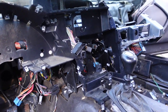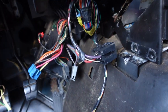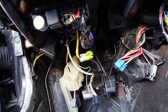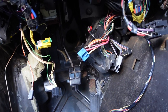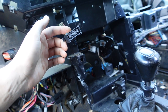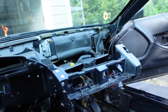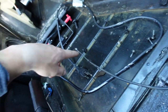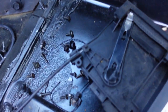I've been taking pictures and this video will serve as a reference if I have trouble putting it back together - where all the wires go. All these connectors: these are the ones that go to the column over here, and this fuse box is mounted up here. The climate controls were just taken out of here. I ended up disconnecting the cable from the blower side after removing the dash pad. It routes all the way in there - I'll save the little clip; it looks just like this one here.